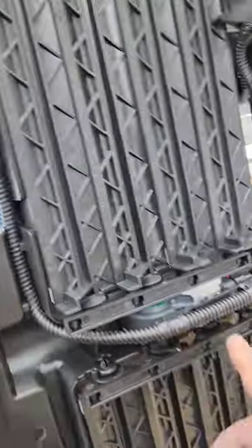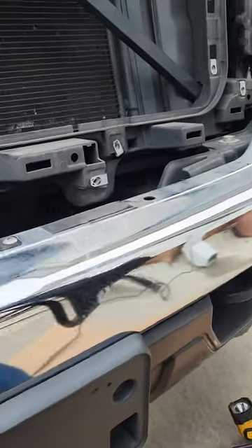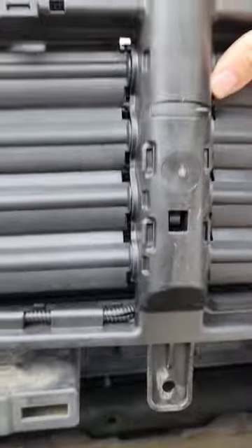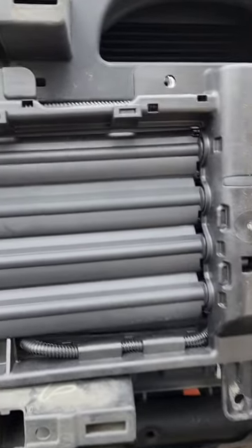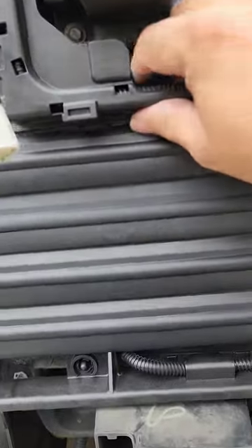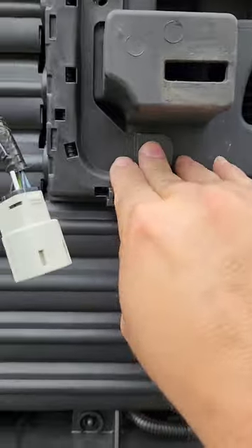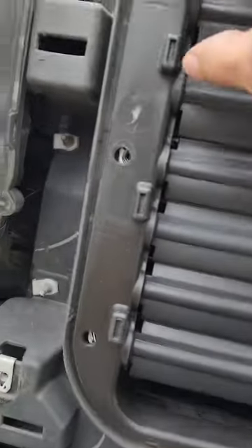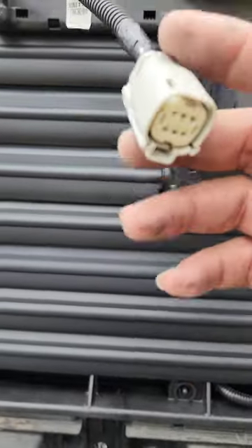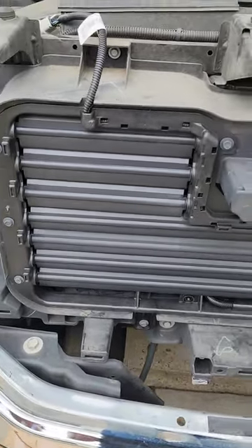Motor goes towards the inside. Shutters are closed when installing. Put them right back where they were — make sure you grab the tab, push, and the rest of your bolts should all line up. Don't forget to plug this connector back in. That should do it.